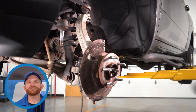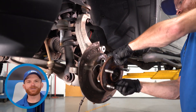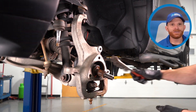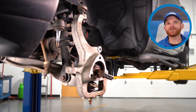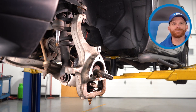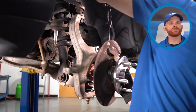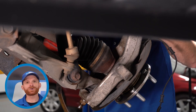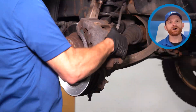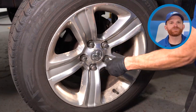You're going to want to remove the bearing from the knuckle itself. To do this, you can use a hammer or maybe even an air chisel along the backside there. We're going to cause some vibration and see if we can get it to pop right out of there. You want to make sure that you clean and inspect that steering knuckle. Any debris or corrosion in this area can potentially cause an issue where the alignment might be off, or even after you hit a couple of bumps, the bearing might loosen up, which overall could be extremely unsafe. After this is nice and clean, go ahead and apply a little bit of copper anti-seize and insert your new wheel bearing. Torque everything to manufacturer specifications, then continue on reinstalling everything you had taken apart.